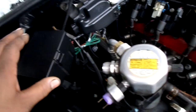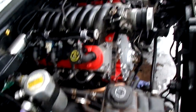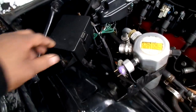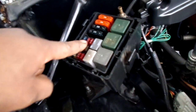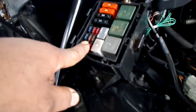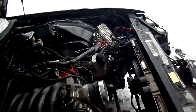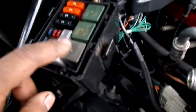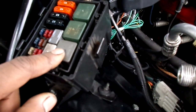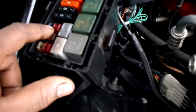I utilized the factory fuse box to give it a clean look so there aren't wires hanging from everywhere. All of these fuses have either a pink or orange wire going to them. After you set it up standalone, I just used the starter wire from the Tahoe, grouped all of the pink wires together, and ran it off the air pump relay — it has everything you need: ground, power, and switch. So this controls the injectors, O2 sensors, and every pink wire in the car, run from the air pump fuse so if anything happens it'll pop.